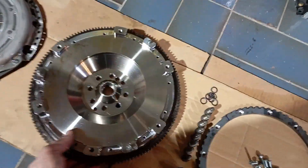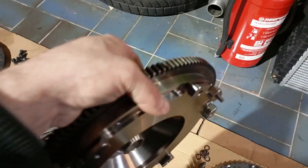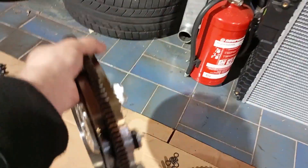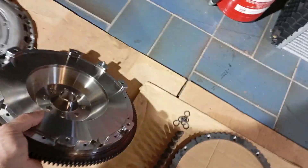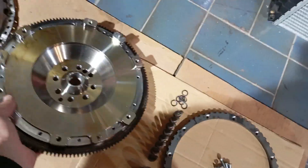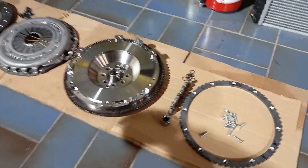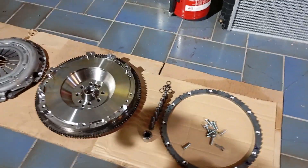As you might already see, it is lightweight — I think it is eight or nine kilos. Compared to a sprinter flywheel which has 18 or something like that, it's almost half the weight. And this flywheel comes with the nice functionality of an exchangeable trigger wheel.